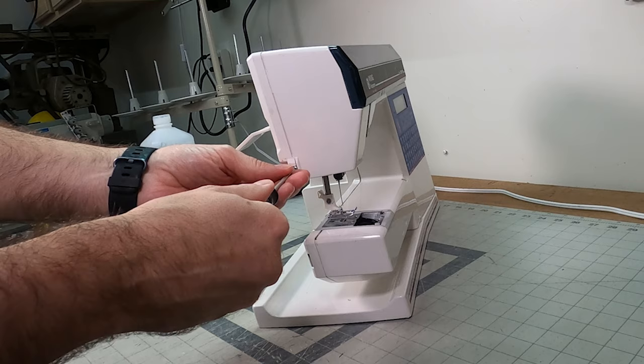Let's go back through our steps. First thing we did was look over the machine — our once-over, scanning over the whole machine looking for problems. Just a basic overview: how dirty is it, is there anything wrong? We had little pieces of thread sticking out of the bottom, and a thread sticking out of the upper tension assembly. Then we got out our brush and vacuum, brushed everything, and vacuumed all the dust around the whole machine — that was step two. Step three was more mechanical cleaning, where we got our tweezers and Q-tips out and got all the nastiness that we couldn't reach with just a brush and vacuum.